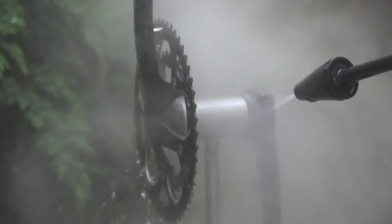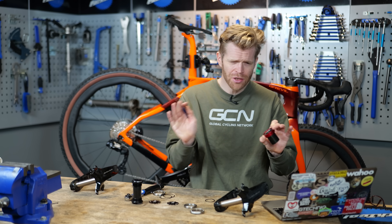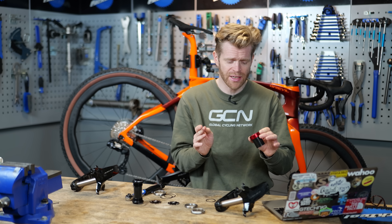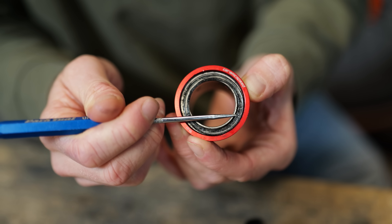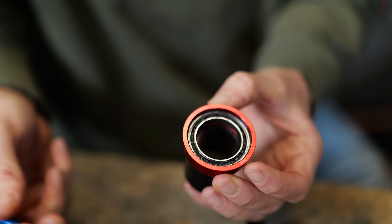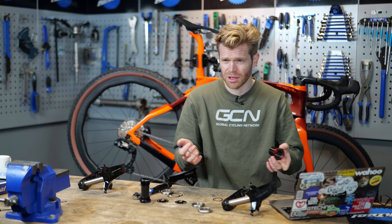The other thing that gets past the seals is when people spray aerosols like WD-40 liberally all over their bike — especially when they use the little straw attachment on the end of the aerosol, the little stick of death. This is the perfect tool for getting past the seals on your bearings. It also contains solvent which will wash out the grease that's in there doing a good job. Don't spray it anywhere near your bike and especially don't try to lube your bearings with it. It's absolutely terrible — don't put the stick of death anywhere near your bike.